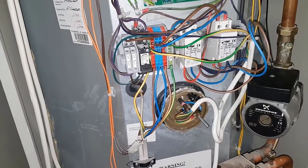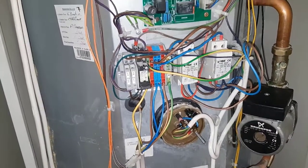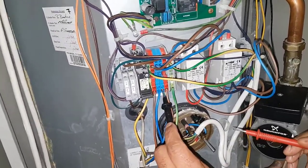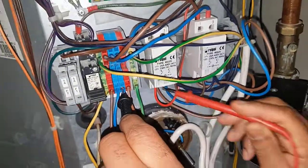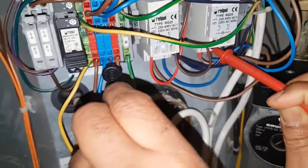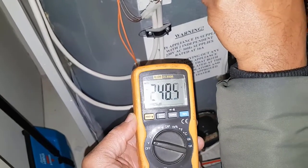So what's happening is it's staying constantly on until the whole thing starts boiling. The customer was terrified when she heard it bubbling with all steam coming out of the top. It's got power permanently on, and the reason is because this relay here is stuck on. We'll go to the other relay next door at the bottom - you've got power coming out of the relay, which that relay should be off.